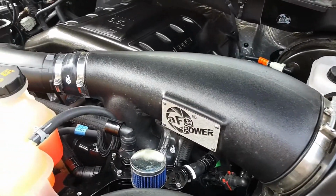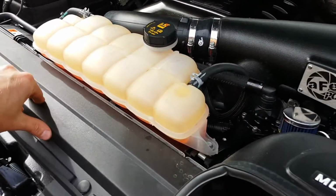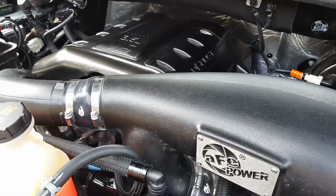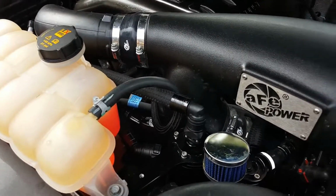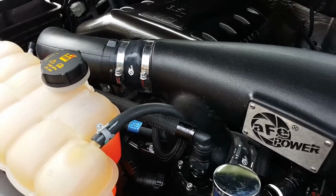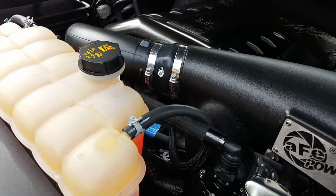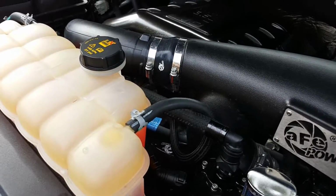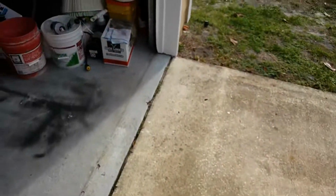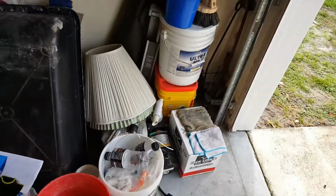pretty straightforward install. Just wanted to remind you guys to have the replacement thermostat up here with the bolts, so once you get everything out of your way and you take the housing off, you're gonna need to quickly pull the old thermostat in, stick the new one in, and then close it back up so you don't lose too much. I lost, I would say, not even a, I think they're 32 ounce Powerade. Yeah, 32 ounce Powerade. I didn't even lose that, but